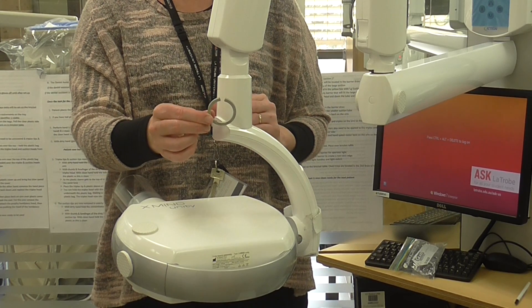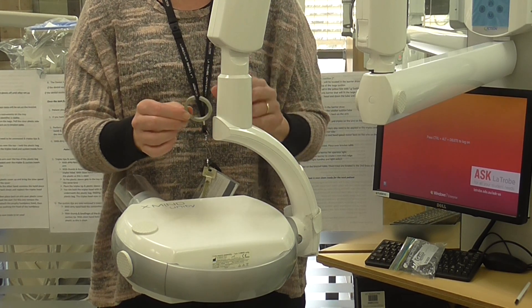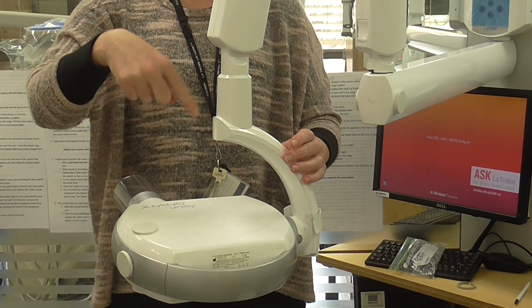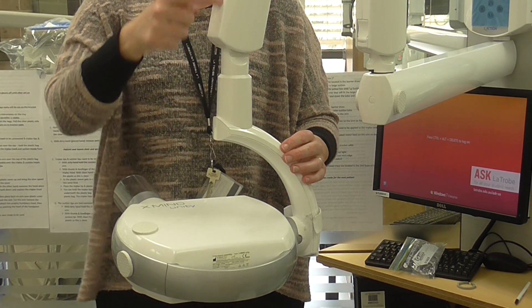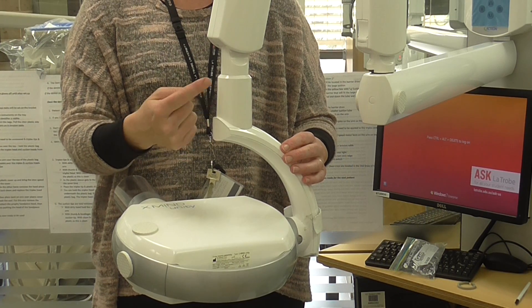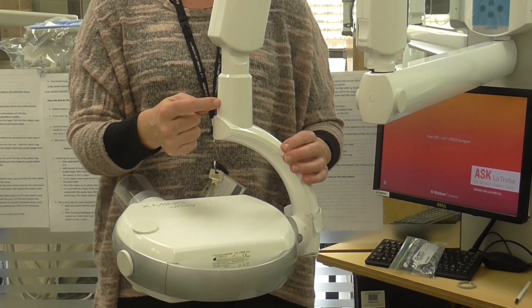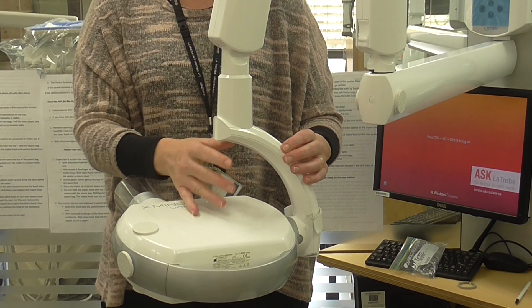You can see that's a broken one there. Once the stopper breaks, the head can spin around and around, which makes the wires inside the head twist up and eventually break. Now the wires themselves can't be replaced — the whole arm has to be replaced.